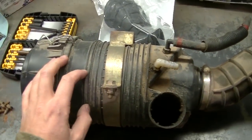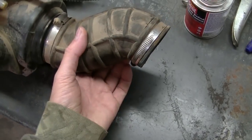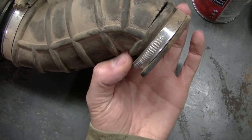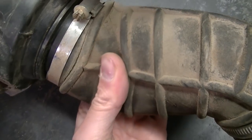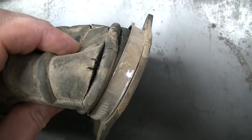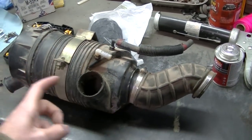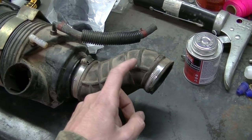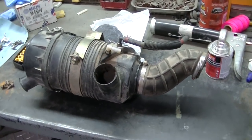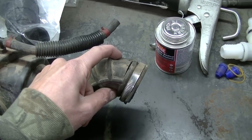Here's the air cleaner completely out. This is the air intake, and here's the boot I'm trying to replace. You can see how badly deteriorated this thing is — it's pretty much shot. This is a very bad thing. You don't want air to go around your filter, because the air coming through is bypassing the filter. Dirty air will destroy your engine. If I had known this boot was cracked, this would have been the first thing I did when I got it.